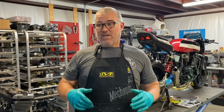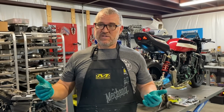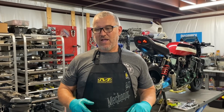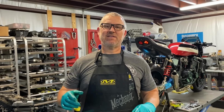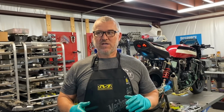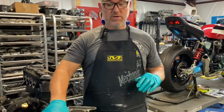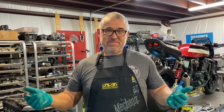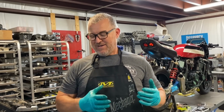I will say this, I've built every type of race engine, all the big 4 Japanese stuff, and Ducati, Triumph, race motors and street motors. Based on piston design, skirt size, engine geometry, rod angle ratio, and all these other factors, we see a lot of cylinder scoring and skirt wear that looks terrible. And those bikes have an air box with an air filter. They're completely sealed up. It's more about how you're side loading things, and how it is driving the skirt into the side of the bore.